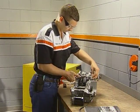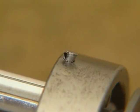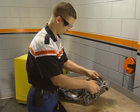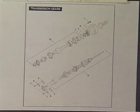Inspect the retaining pin on the bearings and the holes in the crankcase. These pins position the bearings, and if they are damaged, the bearing will need to be replaced. Remove the 2 fasteners from the seal housing and remove the output shaft and inspect the retaining pins on the bearings. Currently, the only components of the transmission shafts that are serviceable are the output shaft seal and the bearings. All other components can only be serviced as a full shaft. Do not disassemble the shafts unless components are made available. Refer to current parts information for availability.